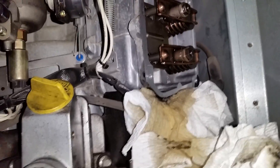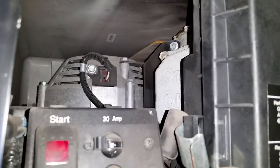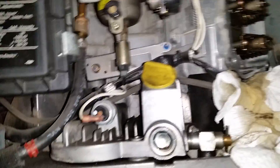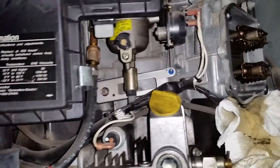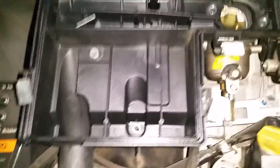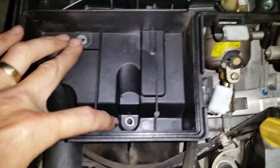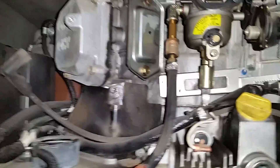Now I know I've got to adjust the valves. To get to the other cylinder head, the other valves are behind the air filter box, so I'm going to take the air filter box off and see what's involved. The cover is simple enough to get off — just a 10 millimeter socket, two screws and two nuts to take off, and that cover comes right out.